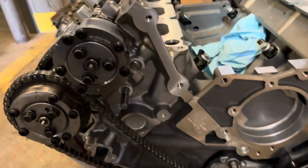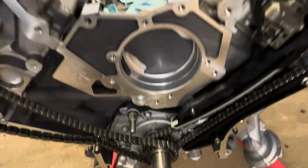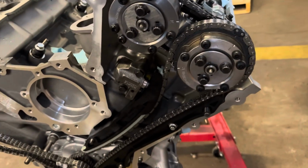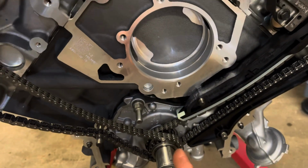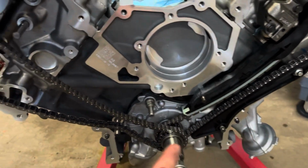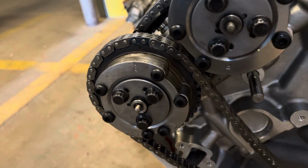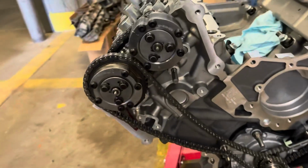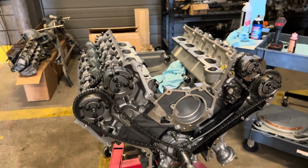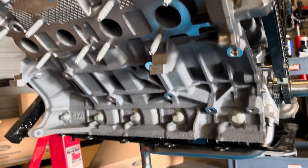All right, I've showed you in other videos where I just have the keyway at noon. I feel like you could time this whole thing like that, because they say 9 and then they say to go to noon after you get the left side done, and you definitely have to do that. There's no way you're gonna time this and get the chains lined up without having the keyway at noon. So get the rest of the guides, tension on there, and then this thing will be all timed up, ready to move on. All right, she's all timed up.